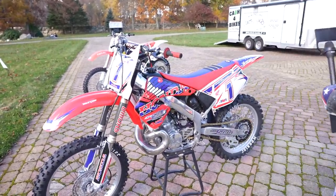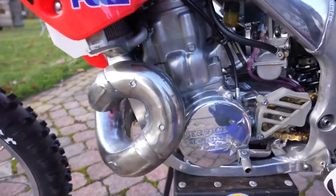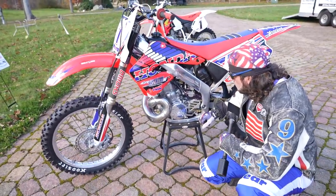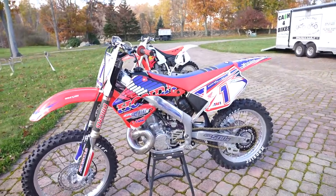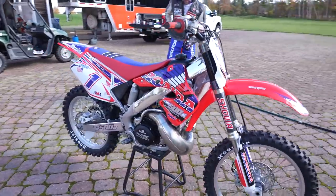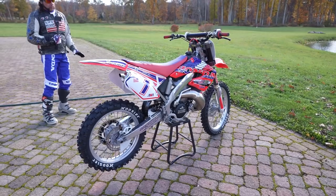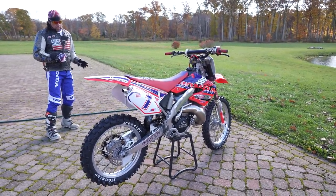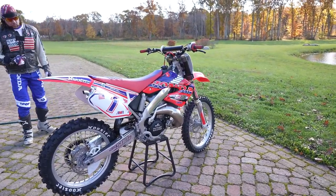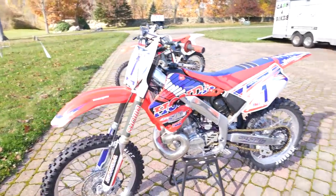This one's ready to roll. Motor's in mint shape. It was actually ported — you can see on the side of the cylinder where it's been engraved. Engine's been ported by Cycle Station. The top end's been refreshed. The cases are in beautiful condition. These are classic big bore two-strokes that never go out of style. These motors are on par with any 500 ever made, and in fact on the dyno they have more horsepower than a 2022 Honda CRF450 — 25% more torque, at least two horsepower more than a regular 450, one horsepower more than a works edition. The works edition dynoed at 52 horse. The base 450 had 49 to 50 horse depending on temperature. The most we ever got on the dyno was 50 horse. These are pulling 53 horse at the rear wheel.